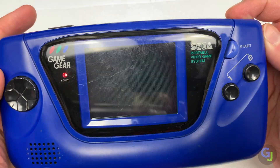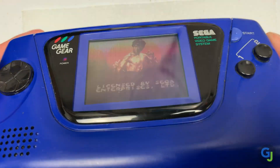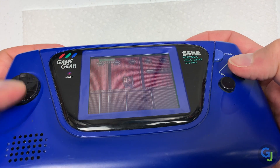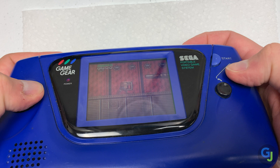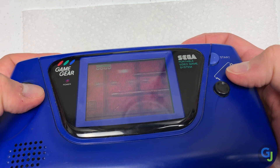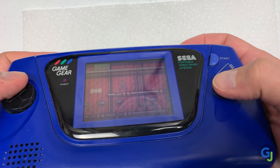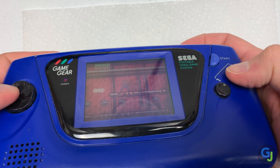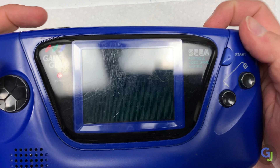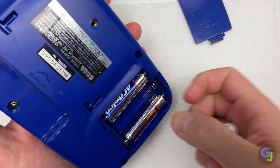Kind of difficult and in no way good for your posture. The good news is the screen works and it doesn't look like it has any other defects like missing pixels or a cracked LCD. The buttons all appear to be working too, and we certainly know the sound is working. The LCD displaying anything is a bit of a surprise to me and we should consider ourselves lucky. When the caps go bad, a majority of the time it displays a blank screen. We at least know this unit is working before we started doing anything on the inside, so if something else is broken when we are done, it's probably our fault.